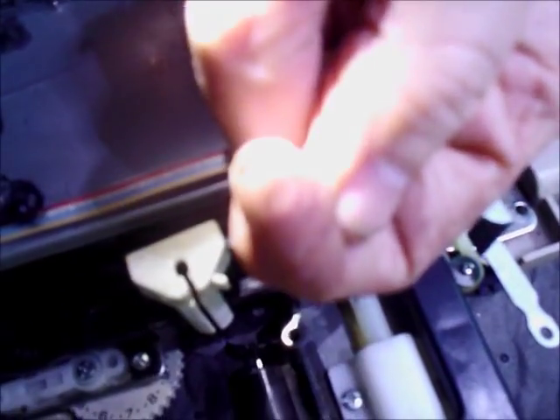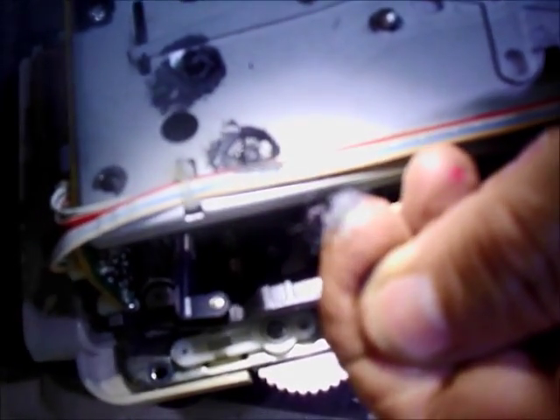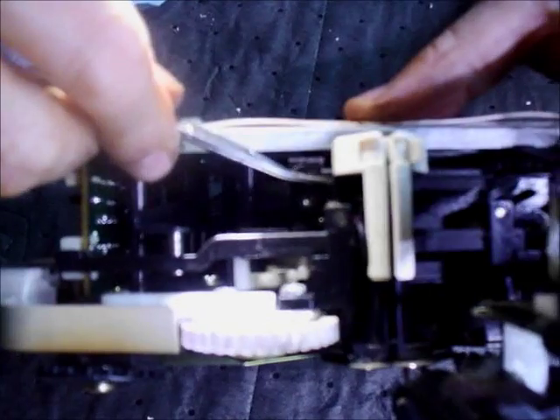You can see some of the movement it has to make — we've got a lot of that old grease and a lot of fuzz that it's catching. Look right here at what we've got under there; all that fuzz continually works down into these areas, mechanisms, gears, and wheels. This area that I'm pointing to with the light — this is what changes direction. You see those slides moving? That is what changes the direction of your carriage when it gets to the end; the feed dogs go the other way because of this change.